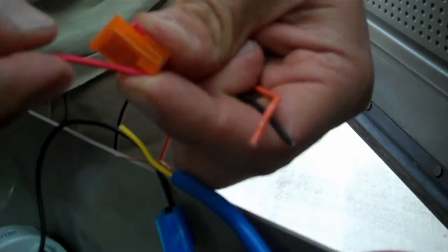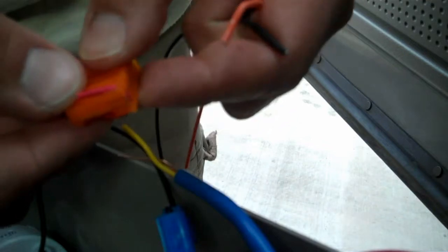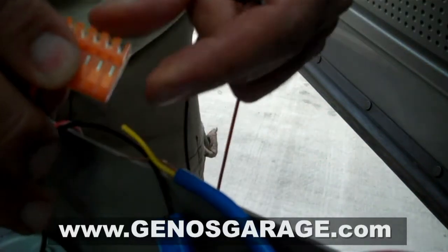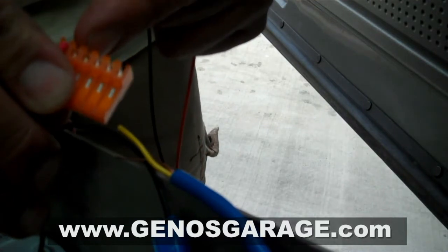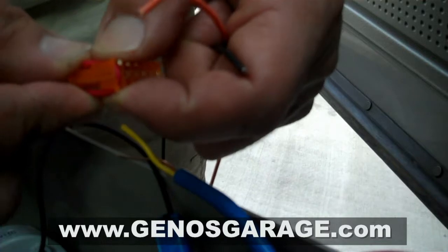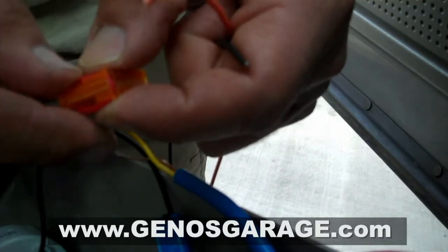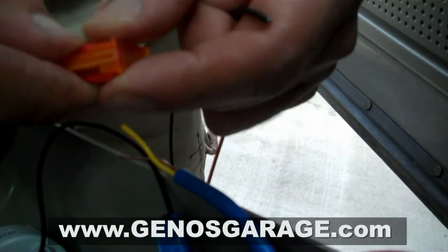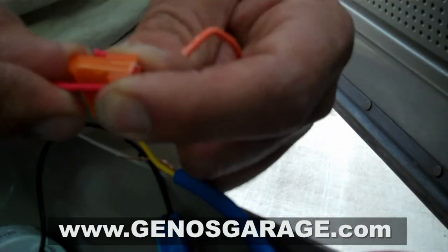Okay, now pretty much ready to go ahead and take the connector and start installing the wires. Here you can see where I started taking the red wire, looped it around here, which will actually be pressed into some quick snap fittings right here. And what I'm doing now is just getting the wire bent so it'll crimp easier in the supplied housing that's given to us to finish the installation.